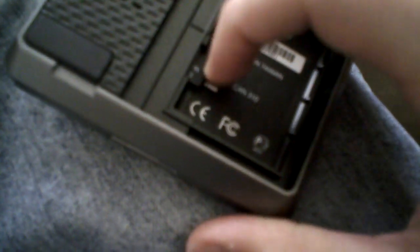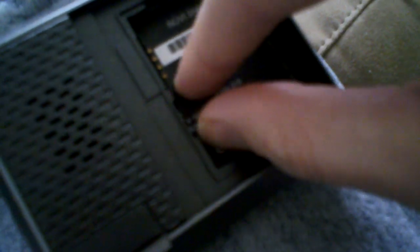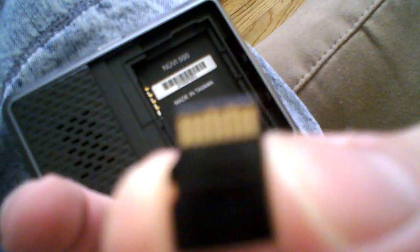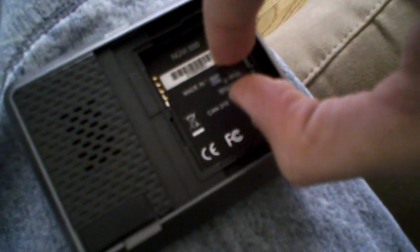The other thing that you need is a micro SD card. These come in all sorts of different sizes, but in doing my research with Garmin, the largest size that the new V550 can take is 16 gigabytes, which is actually pretty big. The SD card goes in the inside — when you take off the back cover, take out the battery, and the SD card slot is right in there. This is a 16 gigabyte micro SD card. You take the little computer components and face it downward when putting it into the unit. Put it into the slot and push it until you hear a click and it should seat itself. Then you can go ahead and put back the battery on your new V550.